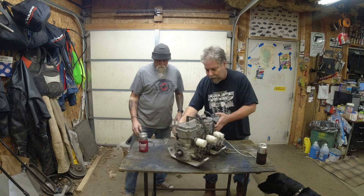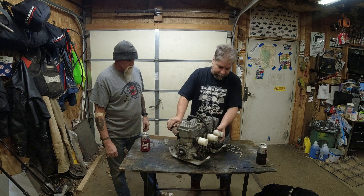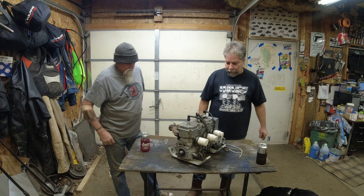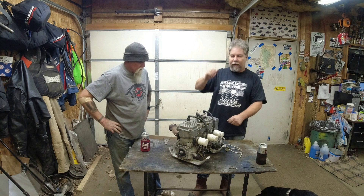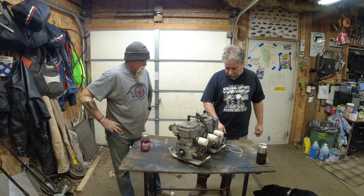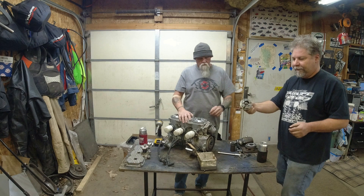Alright, so we're getting our game plan together here. We're going to yank the exhaust off because we take them off to pressure check the motor, and we always pressure check the motor after we do the crank seals. These are for pressure checking - they're already on from when we washed it, just plugs on the carb boots. Lonnie's got the top of his head cover loose, so we're going to take that and the spark plugs off, flip this thing up on its bottom, pull out the motor mounts, get all the flywheel and stuff off too, and split the cases. That's the plan, so we'll just start doing it.